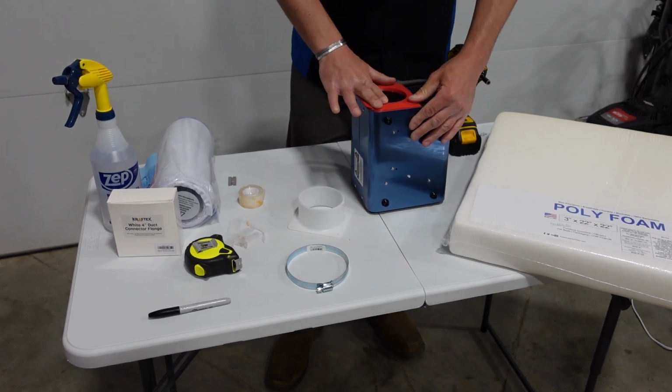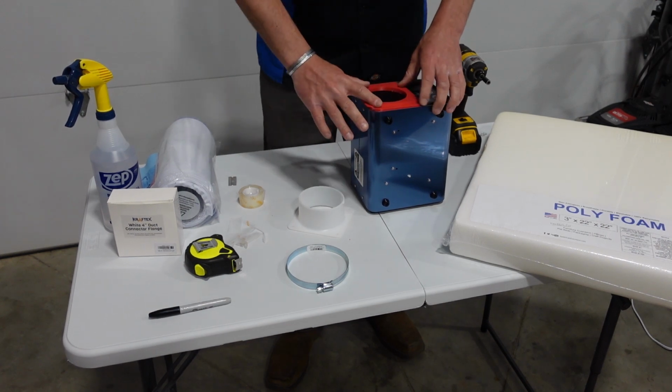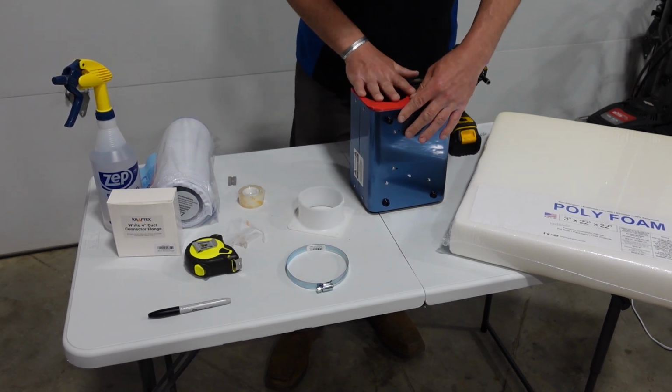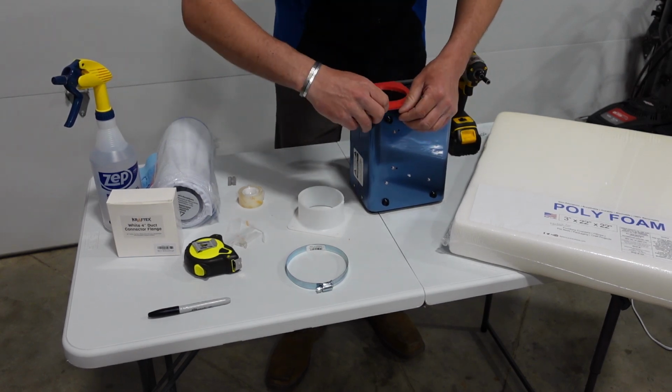If you did a proper degreasing with alcohol, that's going to make all the difference for getting that tape to adhere. And again, I'd like to use screws to just screw it to the front and put some RTV under it, because that would be a nice airtight seal, but I'm going to wait until the warranty expires on this. I believe it has a 2-year warranty.